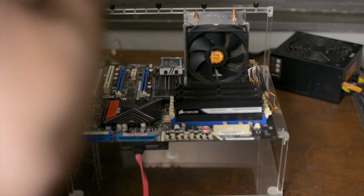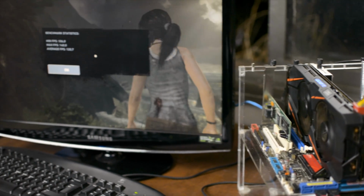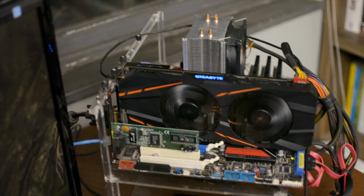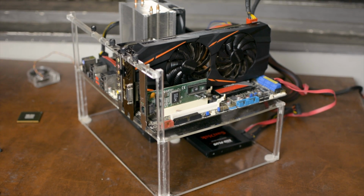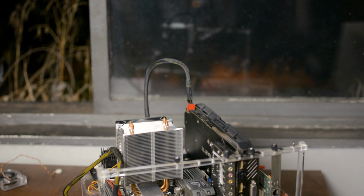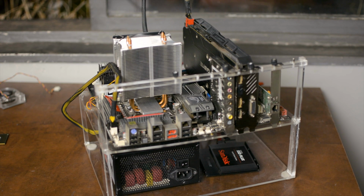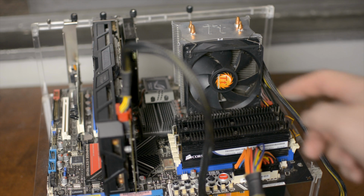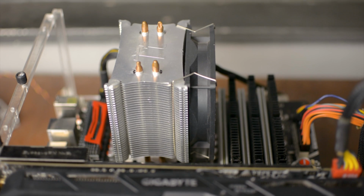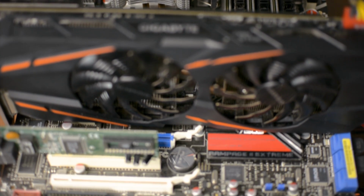For the test platform, we're using an Asus Rampage 2 motherboard with the x58 chipset. In fact, the x58 chipset was the only one to support the 1366 socket CPUs in desktop home computers. There were other chipsets, but only for server applications. One of the coolest features of this platform is the triple channel memory, and of course we're taking advantage of that using 6 sticks of 1333 MHz DDR3 RAM for a total of 12 GB. 12 GB is not ideal to test games in current times, but rest assured, 10 years ago, when all this hardware was created, it was more than enough.